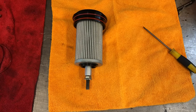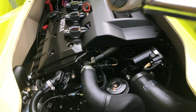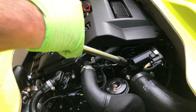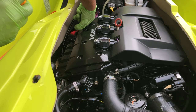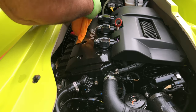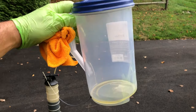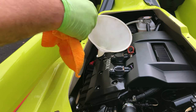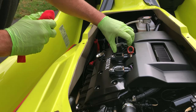We now have a completed oil filter ready to get installed. We're going to torque the oil filter cap down to 85 inch pounds. Now we move on to filling up the engine with oil — we removed about three and a half liters and that's what we're gonna put back in. Make sure your funnel is clean; I like to use a container I can measure, filling it up one liter at a time and adding that to the engine.